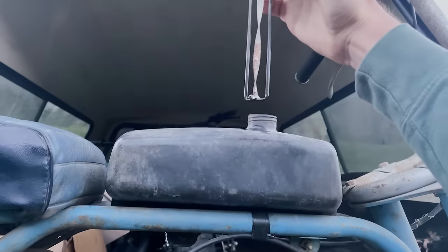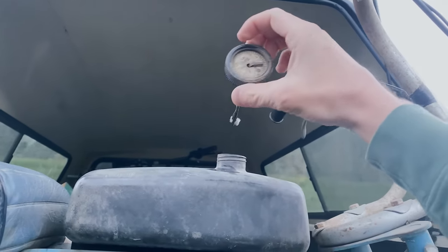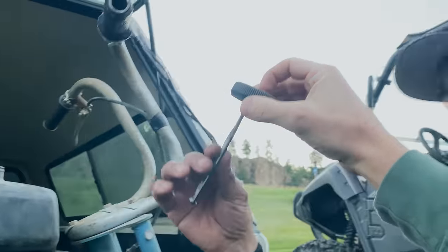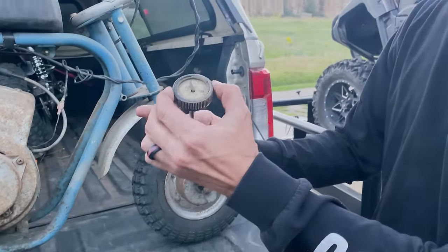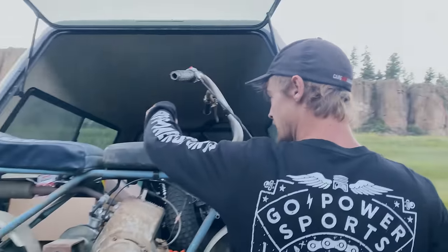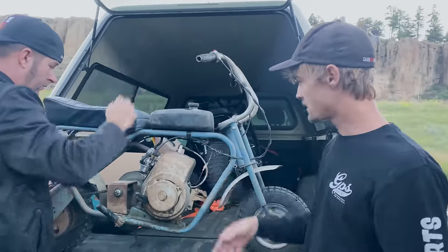I will say, this won't help us tomorrow, but these bikes had very clever gas gauges back in the day. Yeah, there's supposed to be a float on the bottom of this. So when it floats up, it spins that to full, and then when it goes down, it goes to empty. Yep. Simple, and effective, and broken. Well, the float's dry rot, and then I guarantee it's throttle in the works.